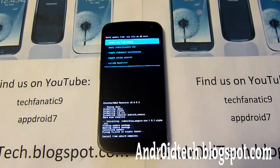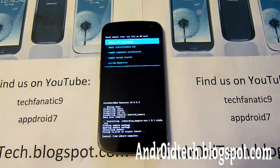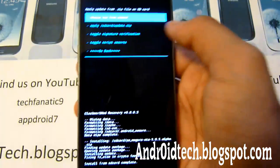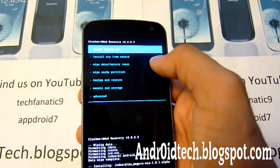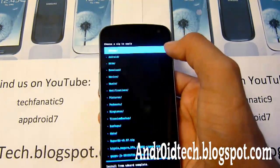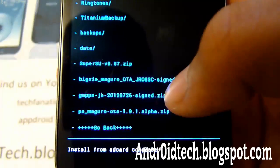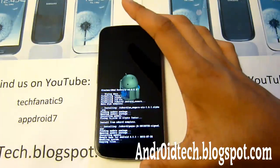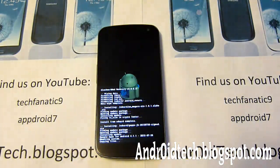Okay, it only took about 10 seconds. It also said in the forum where I read it and downloaded the files that I need to install GApps, also known as Google Apps — Gmail, Google Talk, all that normal stuff. So I'm going to go back, install zip from SD card, choose zip from SD card, and go all the way down to where it says GApps Jellybean — that's mine. I'll choose that one and install it. Once this is done, we're going to reboot and boot into the new ROM.